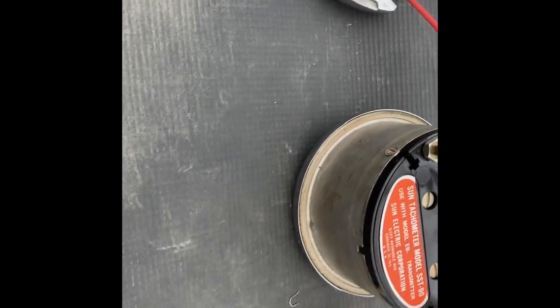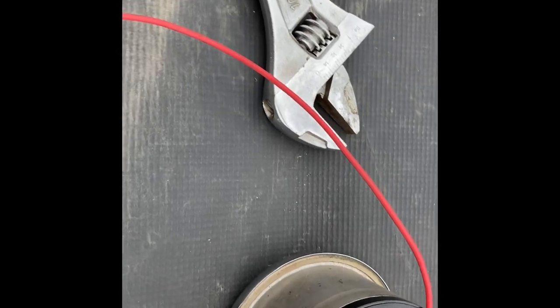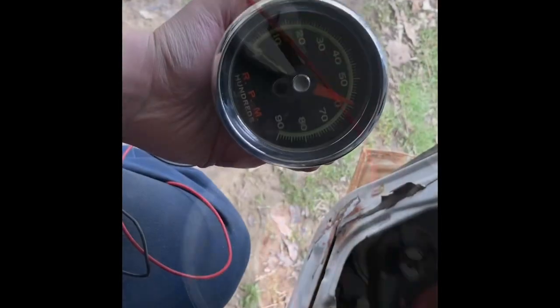That Sun Pro tach had like seven wires - two blacks and then a white, green, red, silver, and black wired into it. I popped the cover off because I could not get it to work, and it's telephone wire inside, guys. Someone tried to rewire this. So this is really only a two-wire tachometer - four if you count the light wires. No wonder it's been in a guy's garage for 30 years. Now that I have it rewired, I'm going to run an alligator clip from the fuse panel to my positive.